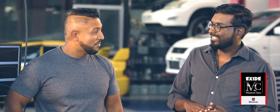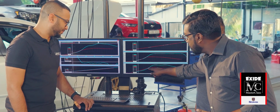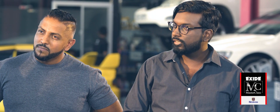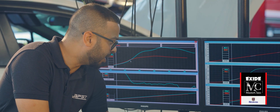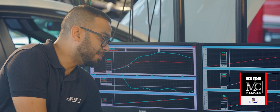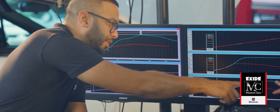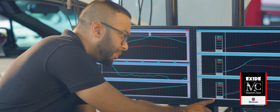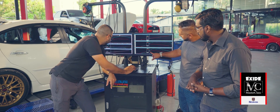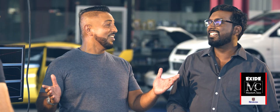That power curve looks terrific, but there is something I see down here — is there a slight drop in torque? You're quite right. Obviously to make more power we had to go with a bigger turbo. The stock Subaru turbo is a 46mm, and this is a 48mm turbo. So we've made a little jump and gained substantially up top, which you can see on both the torque and power. But as Sam quite rightly pointed out, we have lost a bit of torque on the bottom end. That RPM point there is roughly 4,000 RPM — all you have to do is keep the revs above 4,000 RPM and then you're a happy guy.